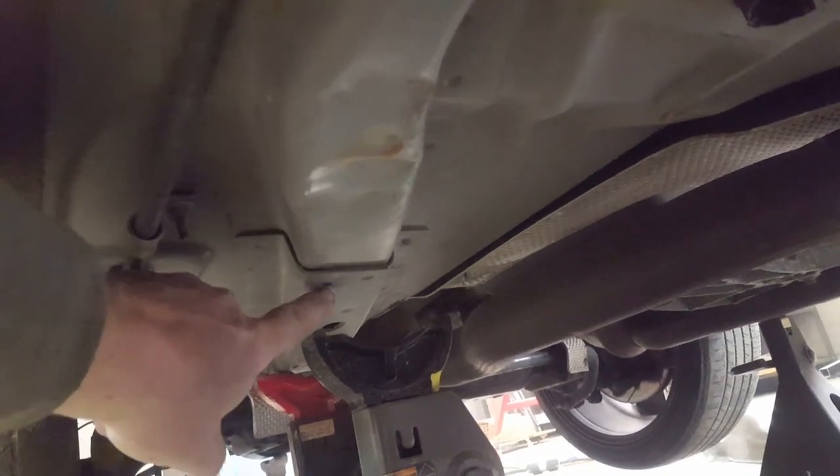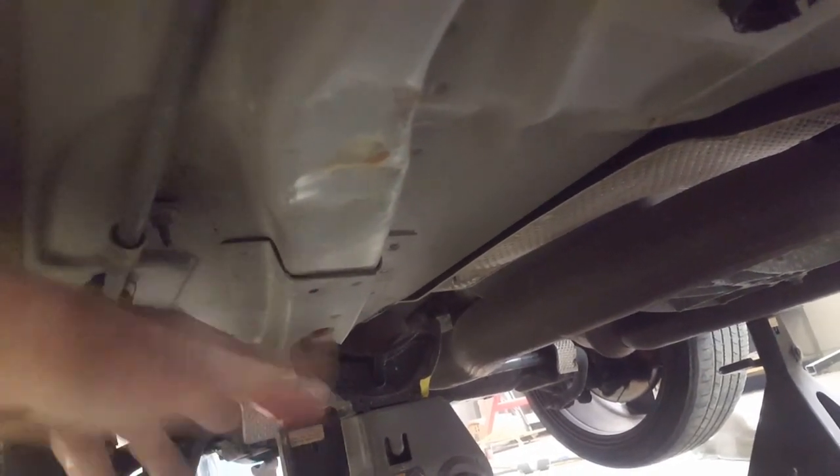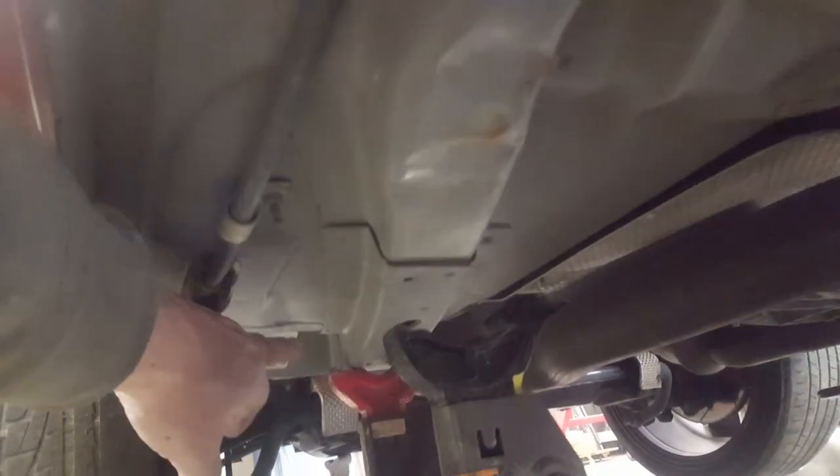You can jack up on this but only at the little area that's doubled up. The problem is if you try to jack up over here and want to put a stand there, your jack's in the way - very difficult to get it supported. You've got to support it way up where there's a vertical strength element based on the firewall coming down here, just before this frame rail turns up. Hopefully adding this eighth-inch angle on here will allow this car to be jacked up from the side in any location along the pinch weld.